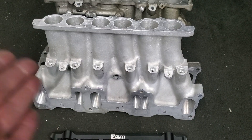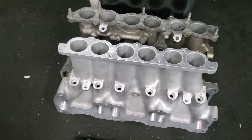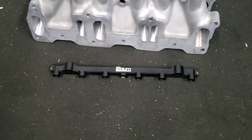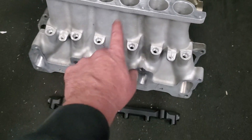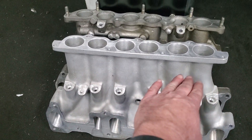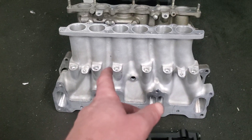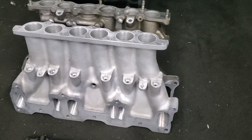New lower intake manifold, welcome to the team. One cool thing about these lower intake manifolds for aftermarket or custom builds — they do offer a shorter height manifold. So if you were building a 20B that either had a low hood height or maybe was in a diverse application, there are shorty manifolds out there in this same casting. It took me a little while to find this one, but they are out there. You can get them both in the full factory height, which I wanted, or in the shorter application if that's what you need.